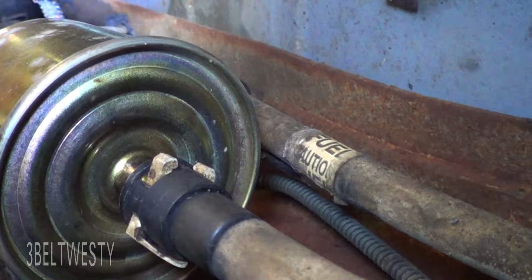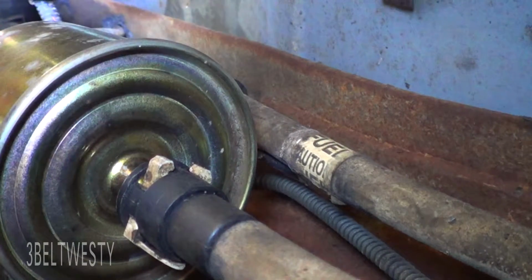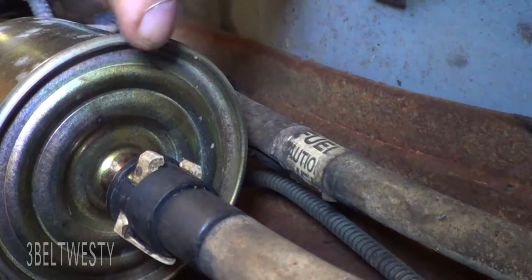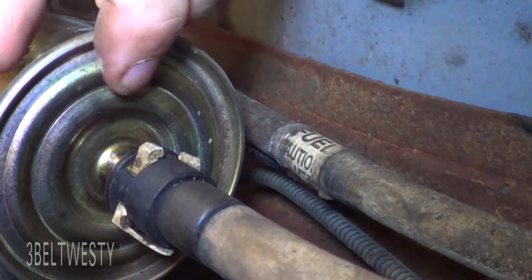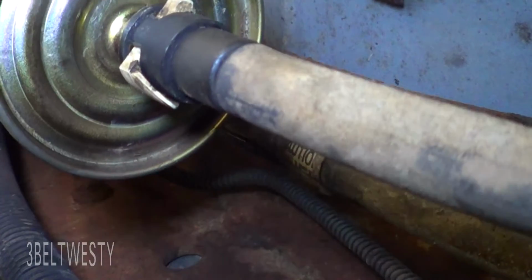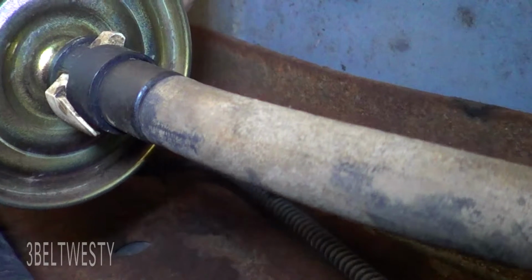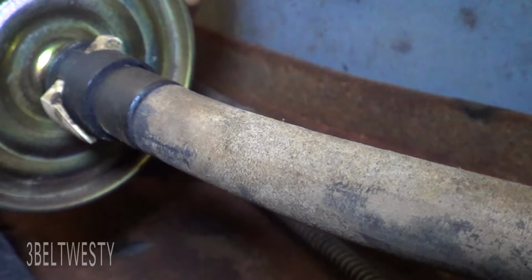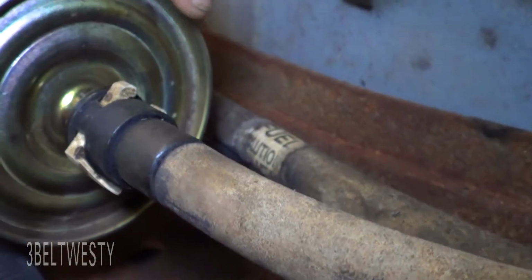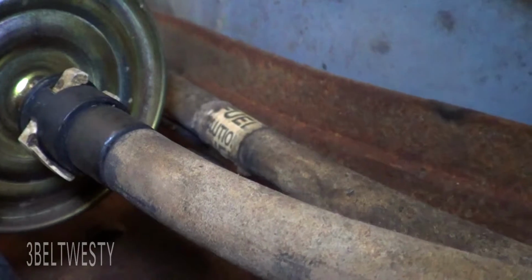And we cleaned out the gas tank prior, but what's kind of weird, I thought it was dripping out of here, and a lot of people told me this was the connector. But right here, when you turn it on, gas pees out of this little hole. So there's a pinhole leak right here where probably the salt, or just the water and the gasoline, goofed it up. So there.